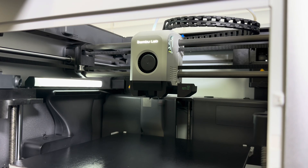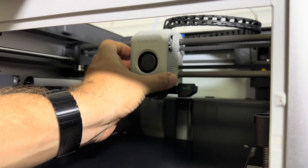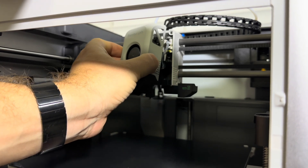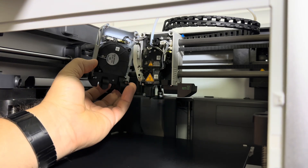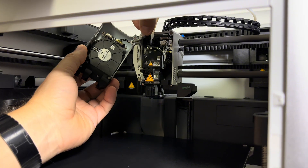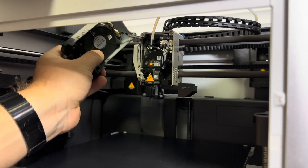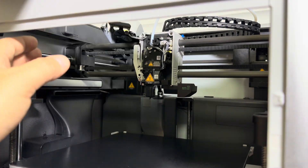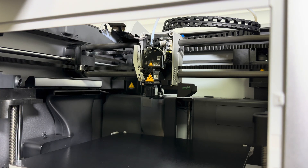What I'm going to do now is turn off the power to the 3D printer. With the power off, we're going to go ahead and remove the front faceplate — it's magnetic so it just pops right off. I'm going to move the front faceplate somewhere up top so it's not in the way of what we're trying to do.